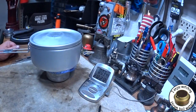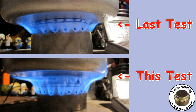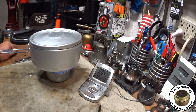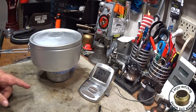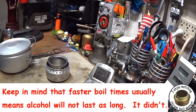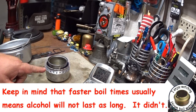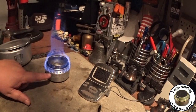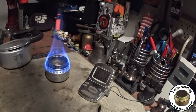Okay so that was much faster. Two cups of water starting at 59 degrees got to a boil in three minutes and 32 seconds. On the last test, just using the stove the way it is, the time was seven minutes and ten seconds — so close to half the time. I guess John's suggestion has some merit, and it goes back to that one-inch sweet spot it seems to be with jets. All I did was put an insert in there to raise the pot up so the distance between the jets and the bottom of the pot was very close to one inch.